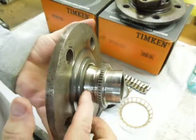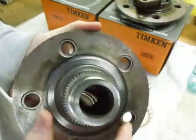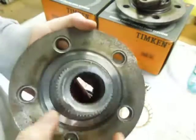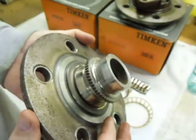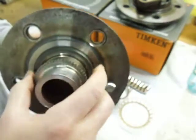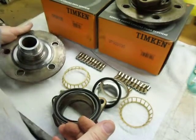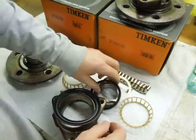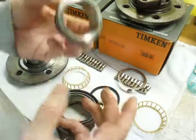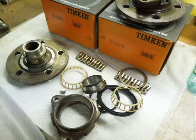If you look at the hub itself, that inner race is in really good shape. The sealing surface is good, so I don't think there was any water intrusion or anything like that. That's your toothed wheel for your pickup on your ABS brakes. And that's pretty much all of it. Interesting how they made it — basically did away with all the normal bearing pieces that you probably would have in early to mid-80s cars. The only traditional bearing-looking parts are the elements in this outer race. I hope you enjoyed the view of the inside of a hub, and thanks for watching.